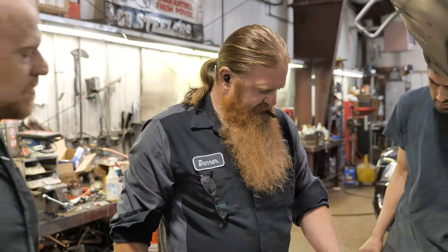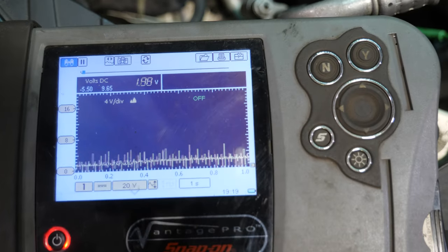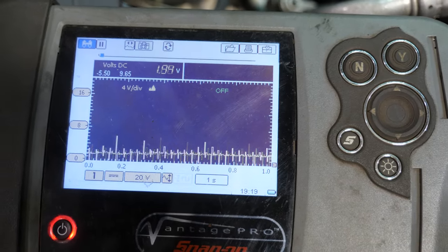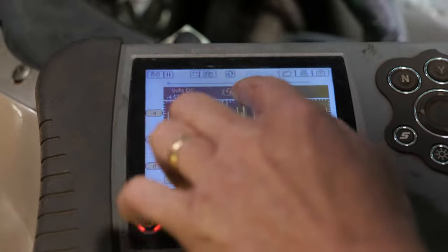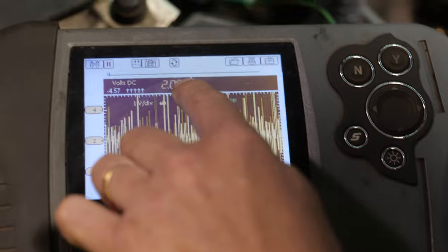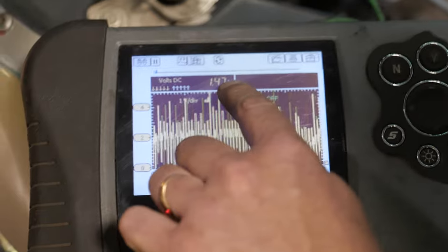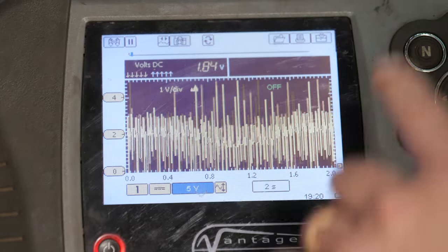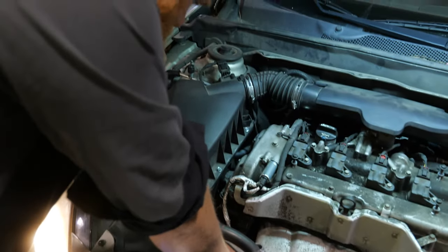Yeah, I'm seeing like 2 volts. That's on the sensor ground? I think the signal bias, and the sensor ground is 1 volt. So you're seeing 1.9 on the signal and 1 volt on the ground. It's the difference in potential, and they do that to eliminate noise. If you look at that number right there, that's your O2 signal. See the 0.6, 0.4, 0.5, 0.7? That's your O2 moving up and down.